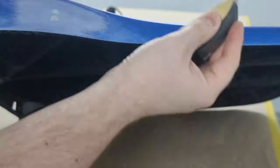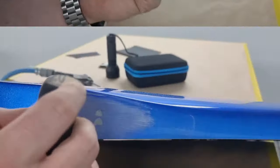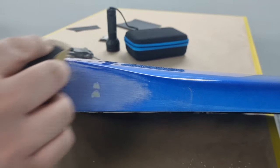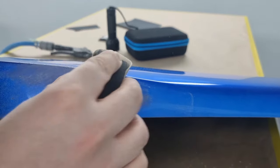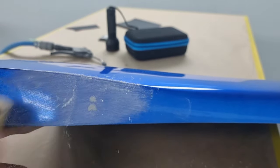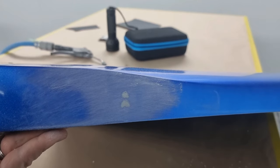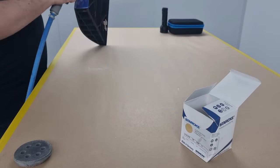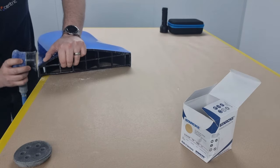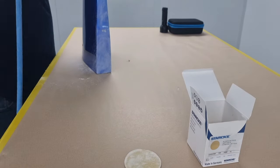We can get away with a fairly standard looking torch priced at a point where it's affordable to keep in your own toolbox. Anyway, back to the repair - there's a slightly heavy edge I've missed, even missed it from the last time we painted it, which should have been polished out. I'm using 320 on a block to rub the putty and that chip out, then taking P500 on the DA to prep the rest of the panel - I'm going to paint the whole thing.